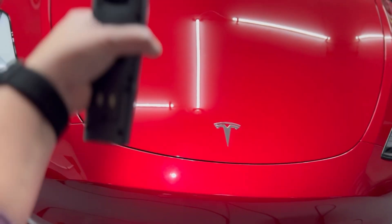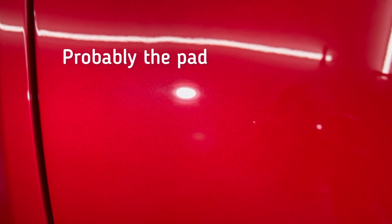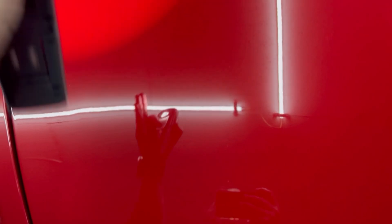Even if it's a new car, I always start off with a white foam pad and a finishing polish of some sort. We tried out McKees 37 spray correcting polish, and even though that was a very gentle process, you can see right around our light we have just kind of these little ticks — that's actually micro marring. We weren't removing a whole lot of the defects either. We were having some ghosting left behind with the pad. So obviously those two products were not the products to use.